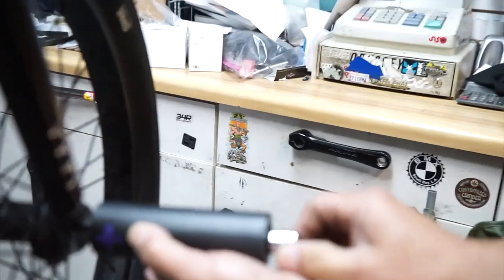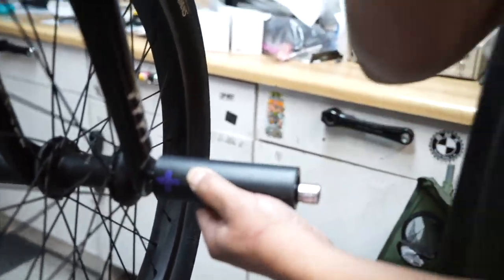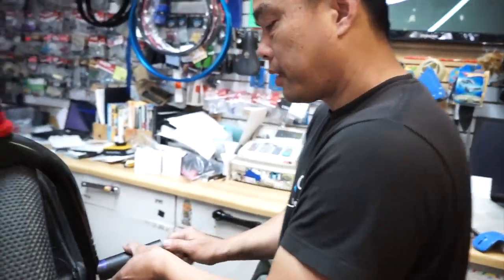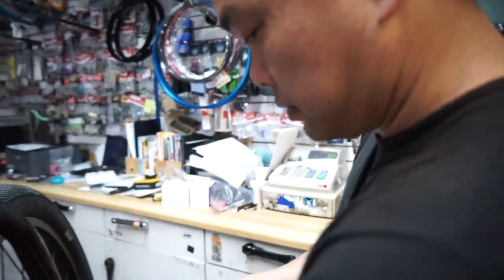Pull the peg back while you're pushing this forward so that little ring doesn't fall off. And remember — do you guys notice what's not in here? The spacer. You don't have the spacer in there — you want to remove the spacer. And some pegs come with different types of spacers, so always make sure it's inside the peg, not outside.